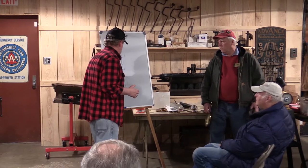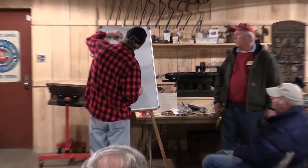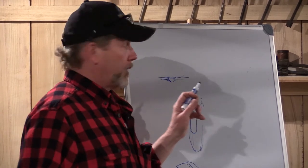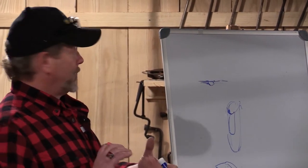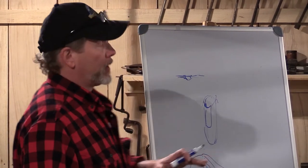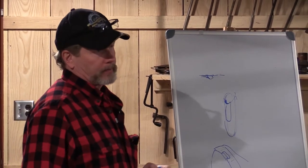What I did with the sample was put a solder blob in there, then came back and ground it down with emery cloth progressively until I could go at it with a buffer. Not unlike other solder, the buffer will pull the solder right back out of the joint if you lay into it. You can get the sandpaper down to 1000 grit and still have scoring you'll need to work out with the buffer. The buffer generates heat and the solder is softer, so it's going to try to take the solder back out — and it does that with silver solder too, it just takes longer.